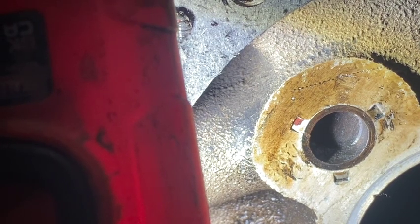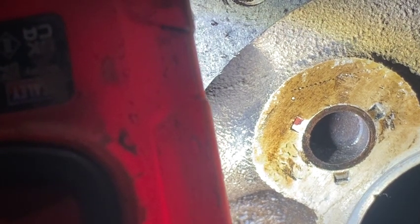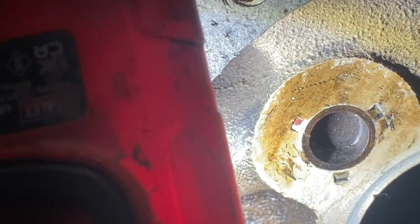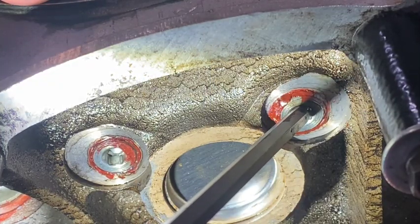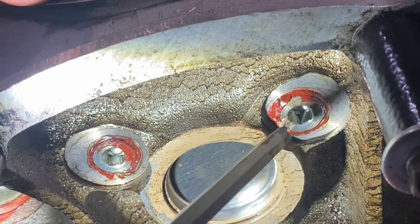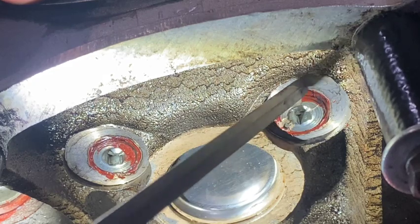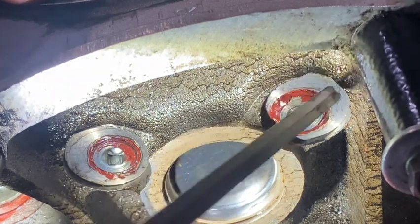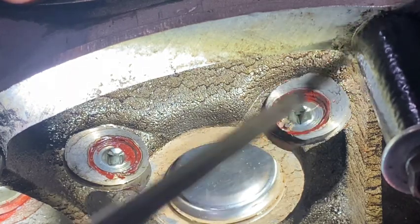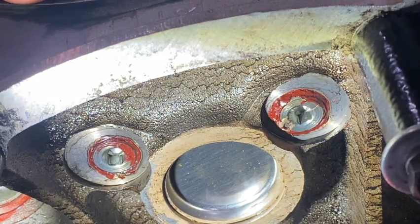The gallery plugs at the front are like a core plug affair with a few extra stakes to hold them firmly in. Various ways of extracting them — it's difficult chopping them out with a chisel; an old school dent puller with a screw and a hole will work, or take out the gallery plugs from the other end and knock them through. These are the plugs at the back of the engine that plug the lifter oil feed bores. They're Loctited in from the factory and are in there really, really tight. Best thing to do — especially if you might have to reuse them, because it's not easy to get ones to suit the earlier P6 blocks and the later ones are metric and don't fit — is to get them nice and hot. Heat them up with a blow lamp and a firm fitting socket and they should unscrew. If they don't want to unscrew, get them a bit hotter.